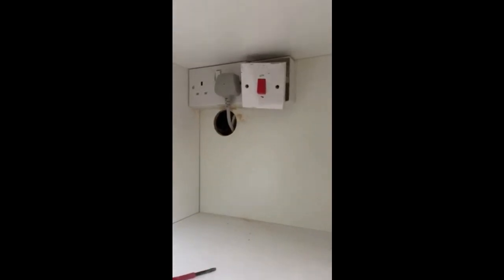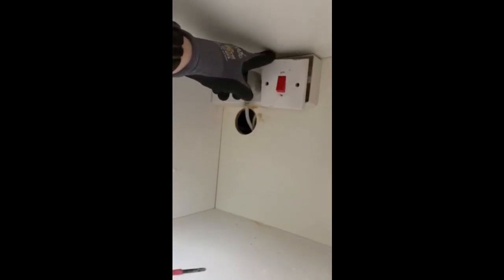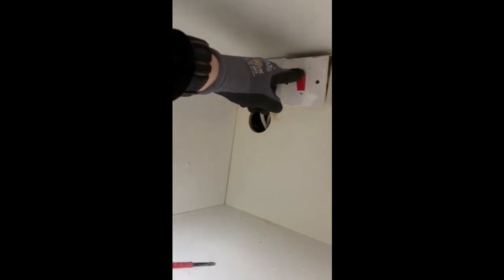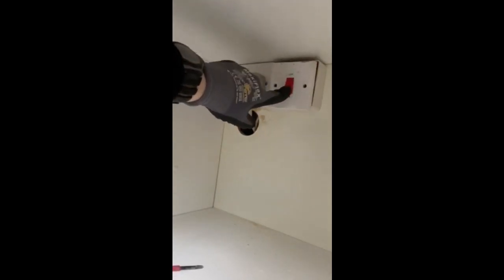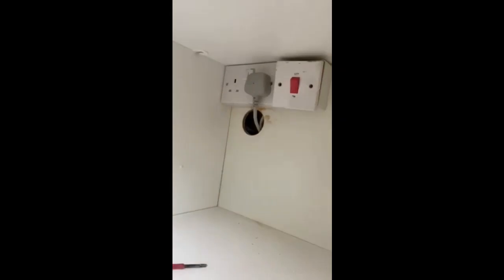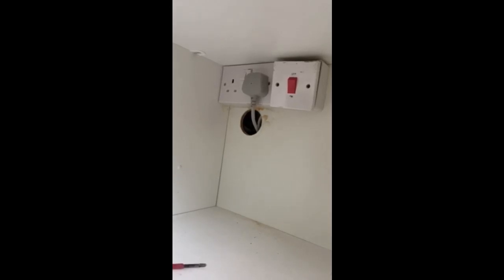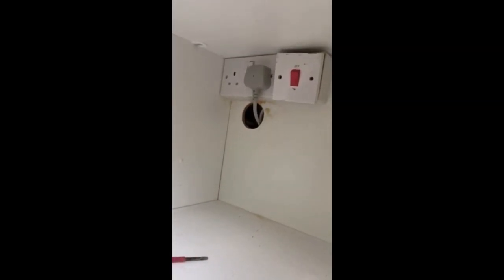Next job is to investigate why the oven doesn't work. We have this oven switch here — I've already unscrewed it, it's not permanently like that. It was very sticky to begin with and wouldn't really turn off, but I must have loosened it. I turned it back on with the power on and the oven bleeped but didn't display anything on screen. I carefully pulled the oven out — typically it wasn't screwed in at all — and found it's hardwired at the back, but rather than going to a cooker connection unit as it should, it just runs straight down into the floor.